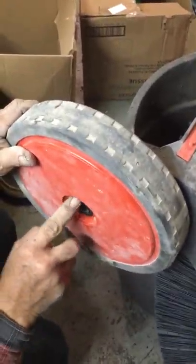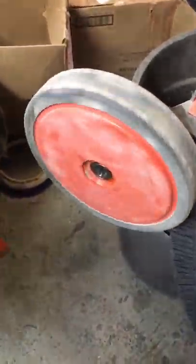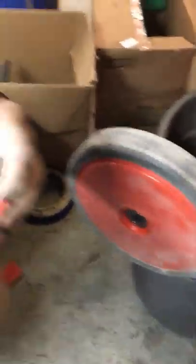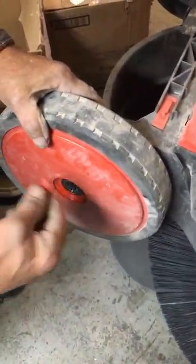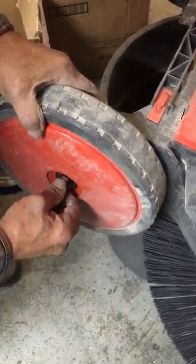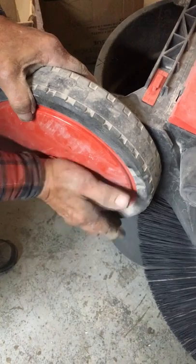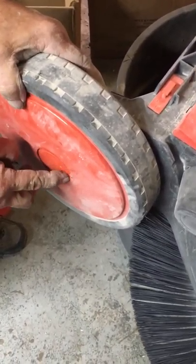Take your right wheel, install it on the unit with both hands and apply pressure. The wheel should turn free and the shaft should be flush with your bearing. Take your wheel clamp, make sure you haven't lost your spring pin, insert it the same as the other side — clamp up, clamp down, push to your click. It should be recessed 3/32 of an inch.